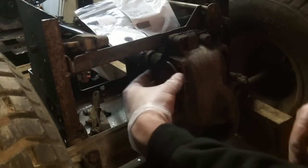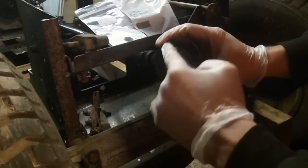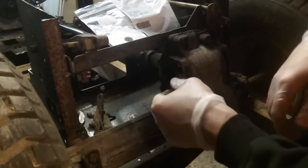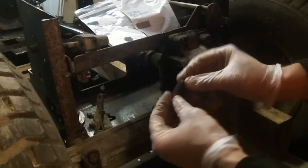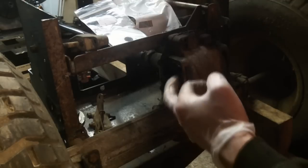At this point we're going to pull our rotor off, which just free-floats, like such. As you can see, this one had scours in it — it wasn't hitting on certain areas. The other side actually has blatant spots missing. You can pull your puck out, and usually this will be the side that's actually scoured thinner, which is why I just bought a singular one to put in here.